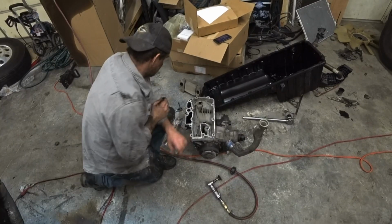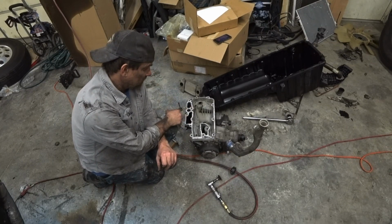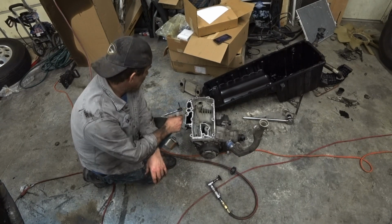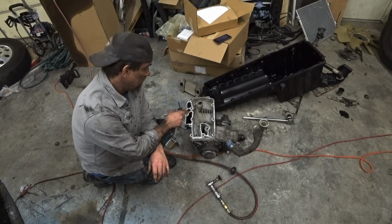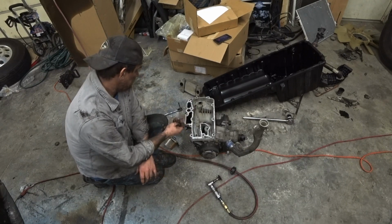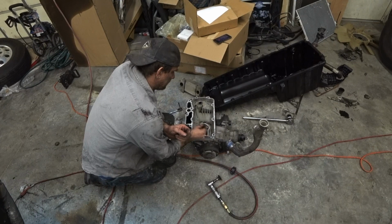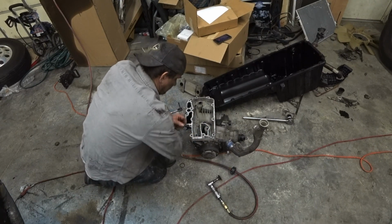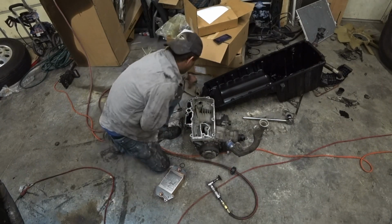Alright guys, next we're moving on to the oil cooler. So, oil filter assembly. Got your water pump on there and everything. These leak in these Freightliners. They're known for it. It's these two little O-rings right here. They're just an O-ring and they get hard and everything, and they sit right down in here. This is your oil cooler right here.